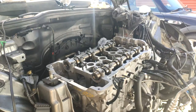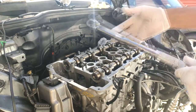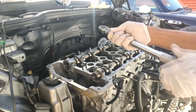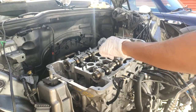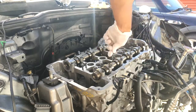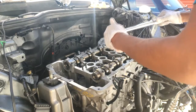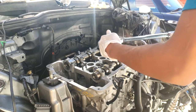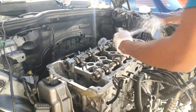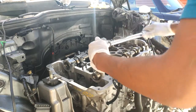For this job I'm going to use my shorter torque wrench — a clicker. Set this to 7 pounds and start with the center most bolt, working your way outwards. One, two, three, four, five, six.